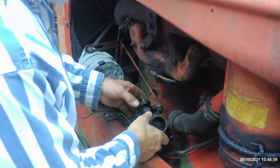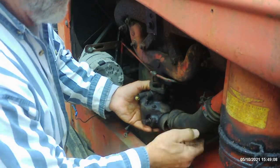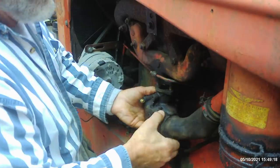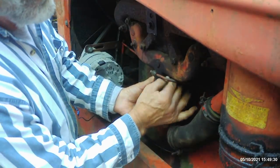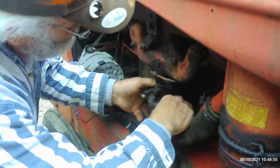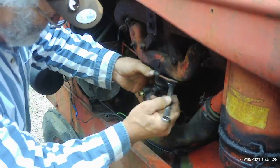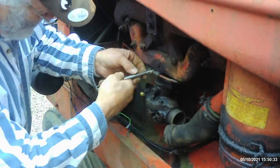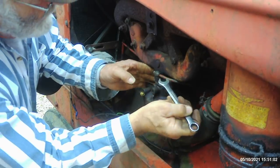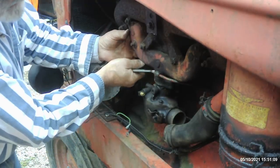The battery died so I don't know what I missed, but I've got the choke linkage connected up as well as the governor linkage. You've got to have them snug but not crazy tight, because you don't want to split something up there — but you don't want a manifold intake leak either.